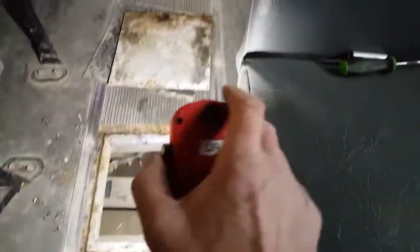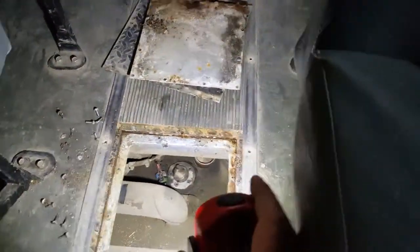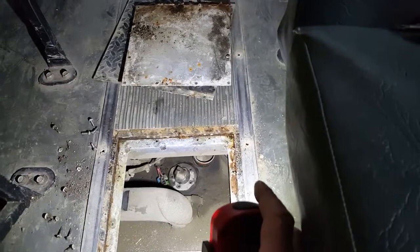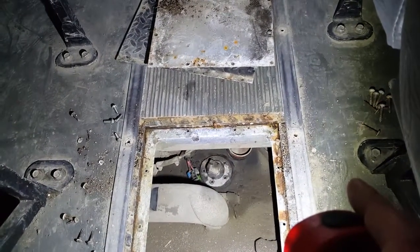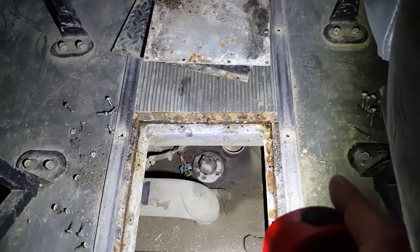Most of the time it's a level sensor, unless you have faulty wiring or something. There's an access panel — all school buses have this, which is an excellent idea. We just got access to the top of the fuel tank, and there's the old sensor. It screws in and plugs in, so it's pretty basic. This is the new sensor.